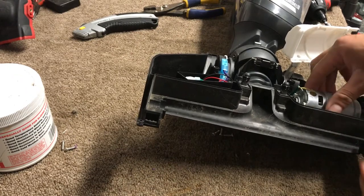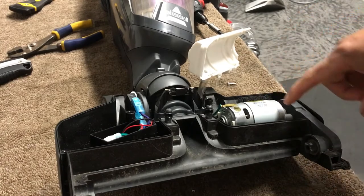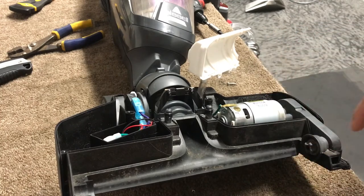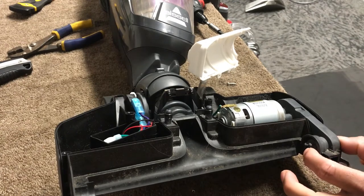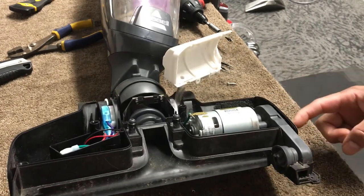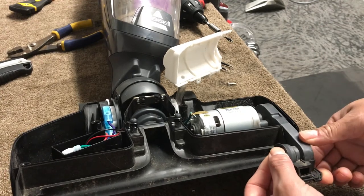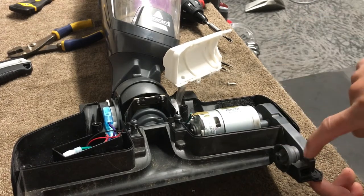This is what turns the brush roll on — you have a DC motor turning the brush roll, and there is a gear mechanism with a belt that drives the brush roll. When something gets stuck, it turns off the machine. In this case, this one is so corroded inside, and I bet there's a lot of hair inside the bearing.